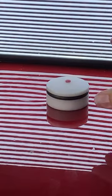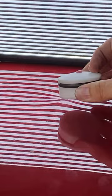The sharper tool you go, the better, okay, at this point. You don't want to go soft tip. That's another big rookie mistake. You go soft tip, you end up stretching way more metal than you have to. I'm really trying to just condense that center. This normally works for any other type of dent, but when you get 17 pounds of pressure with a hockey puck on a glue on the end of it, you guys know what I'm talking about, like this. This is what it was made with, an air cannon hitting it at 17 PSIs, okay? Technically this would not work at a Dent Olympics because it's just too sharp, too stretched.